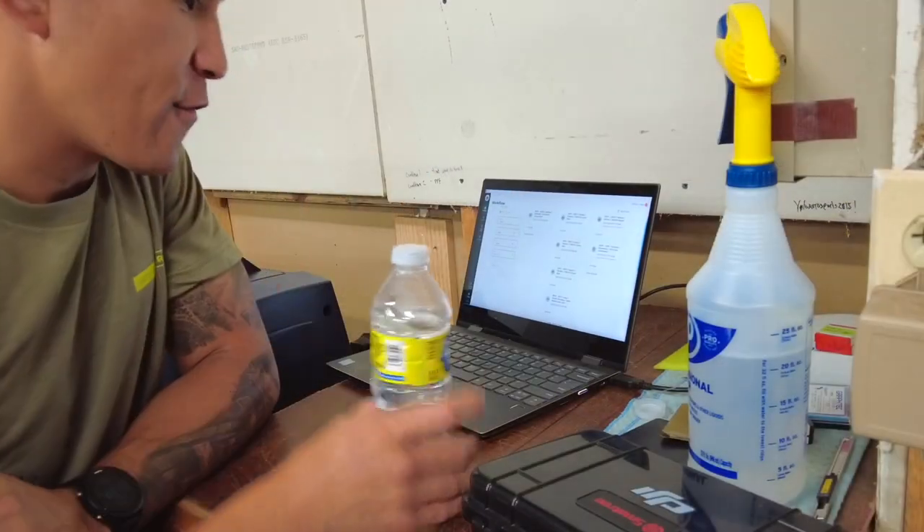I took a look at all the windows from the inside, and it looks like you could definitely two-step this vehicle. But if you're a person who likes the bottom load, I'll show you how to remove the sweeps inside your door panels. On this one you just have to pull back the top edge and you should be able to get the sweep out. We're going 30 percent all the way around on a ceramic film from Solar Effects.